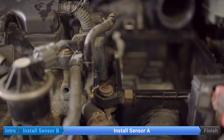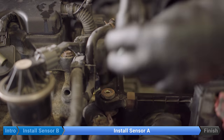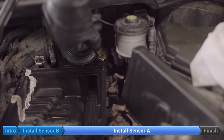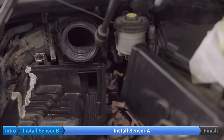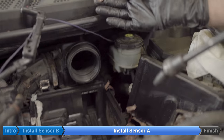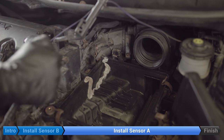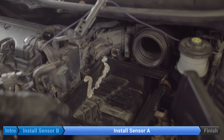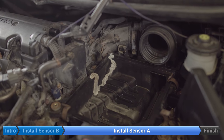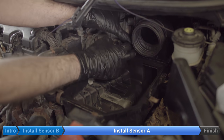Now we remove the two 10 millimeter bolts. The first one is on the front left side near the coolant temperature sensor. The second bolt is down here, also 10 millimeter — you're going to need a 10 millimeter socket, a couple of extensions, maybe a U-joint to make it even easier to get that out. The airbox is also held on with a rubber grommet right here on top of the stud. To get it off, you're going to want to pry up from underneath and pull straight up — you don't want to pull on one side or you could end up cracking the airbox in half, which I totally didn't do. Then pry off the outlet going to the throttle.